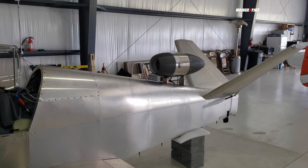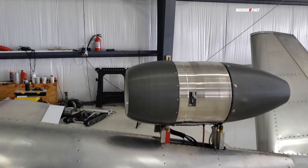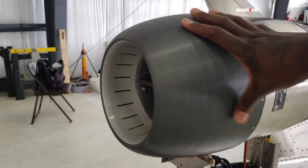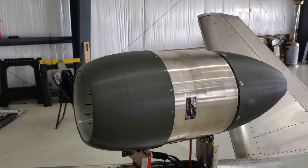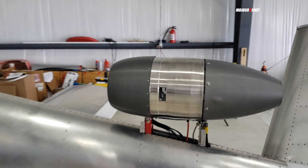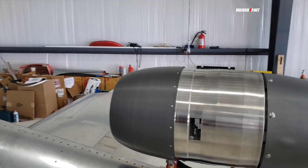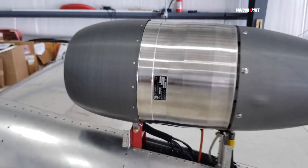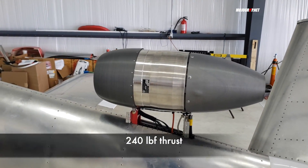Let's talk about this engine. This is your jet engine turbine — it only uses Jet-A fuel. It's incredible that something this small provides the power to move you. I've never seen anything so small yet so powerful, and the price tag confirms it: this engine by itself costs more than the entire kit. The engine is $65,000. This is a PBS TJ100 — a powerful engine. Don't let the size fool you; you've got about 240 pounds of thrust at full power.